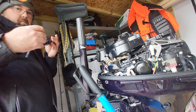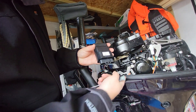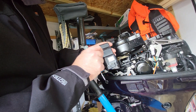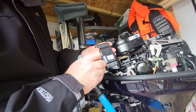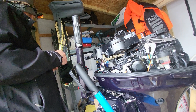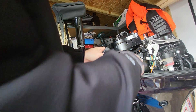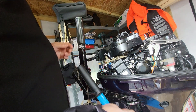There we go. There are actually two holes here where the socket itself clips up into it. You need to push the ECM down to get some wiggle room, then push something through each side there, just gently. There's the socket for the ECM. Let's plug the new one in — not the old one back in, that'd be embarrassing. There's a solid click to tell you it's locked back in.